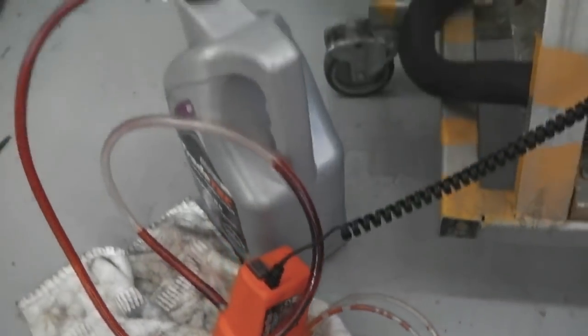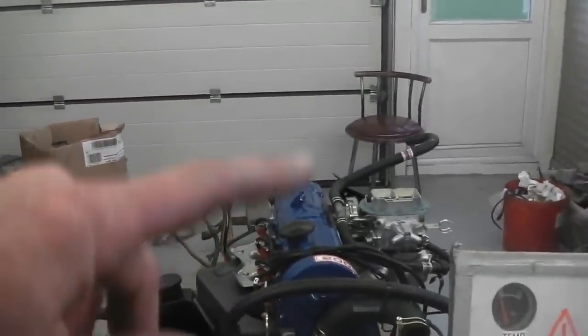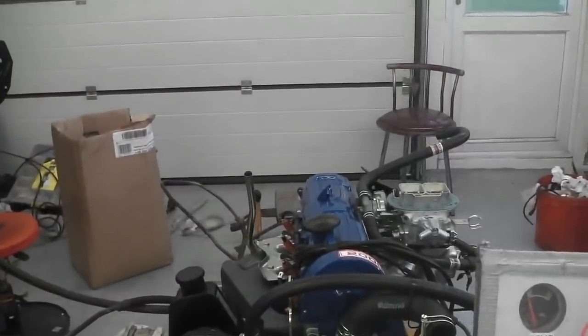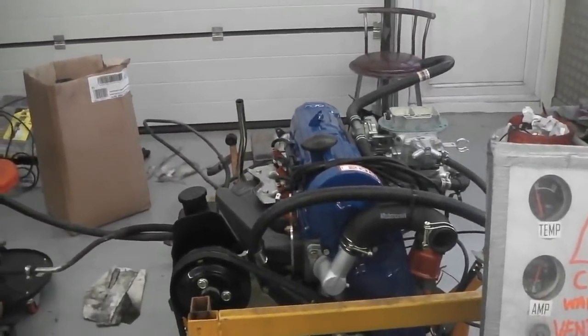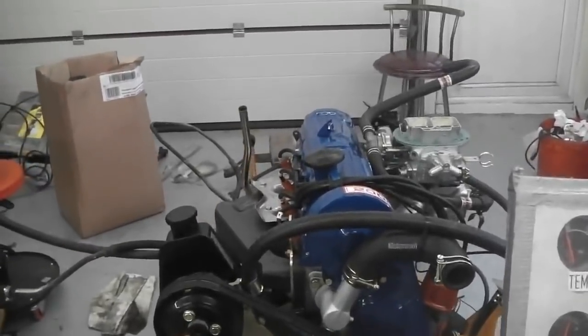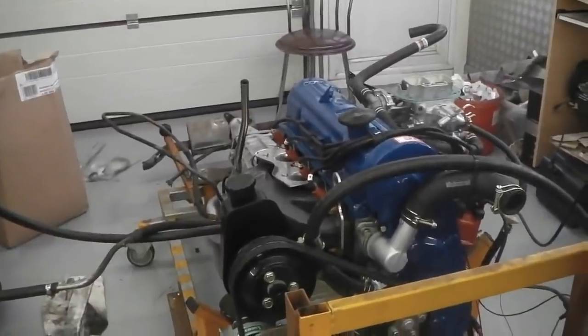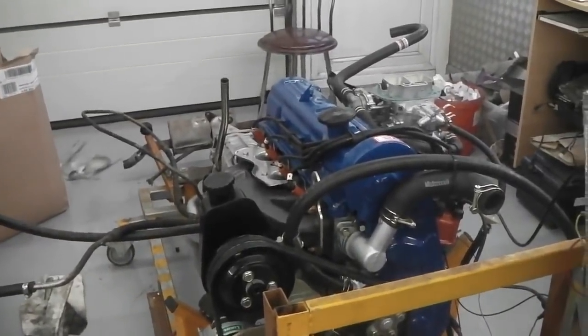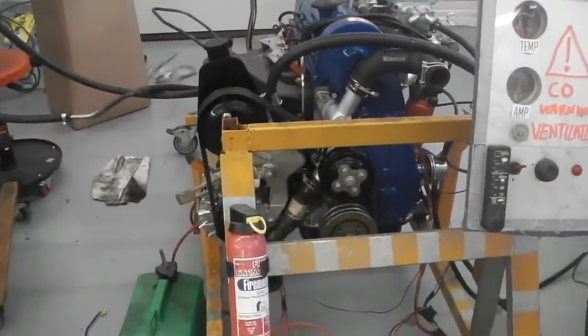We're going to place that into the gearbox and get some oil in, because what we don't want to be doing is even trying to turn that box without fluid in it, because it's used to lubricate and move everything. We don't want any automatic gearbox pumps running dry. We don't want a power steering pump running dry. So before we even try and fire it, we get those fluids in.